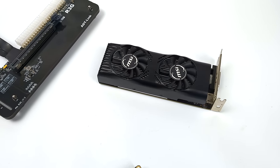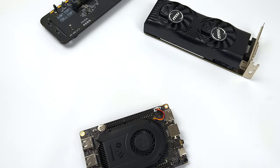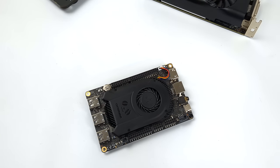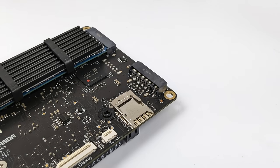Unfortunately these don't support Thunderbolt, so the only way to get an external GPU working with this is over an M.2 slot, and luckily we do have two on this unit. We've got one M.2 B key which supports PCIe 3.0 1x, and the other is an M.2 M key, really made for an NVMe SSD, but it's running at PCIe 3.0 2x. So I opted to populate the other one with an SSD — it's just a SATA M.2 — and we're going to be connecting a GTX 1650 to the M key slot here.